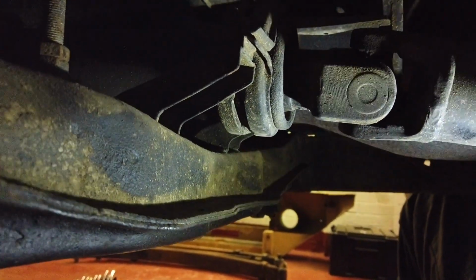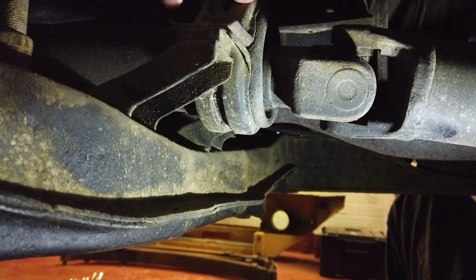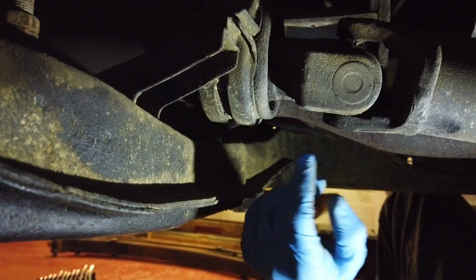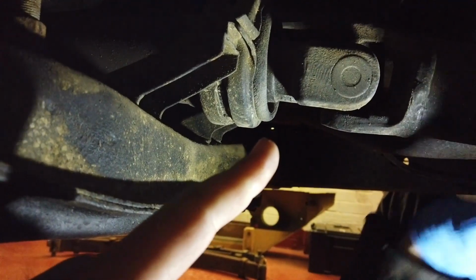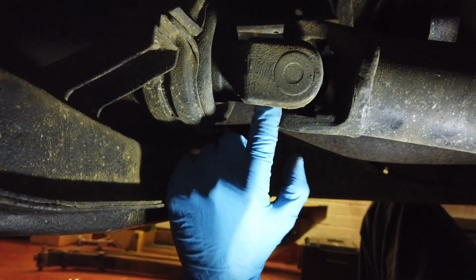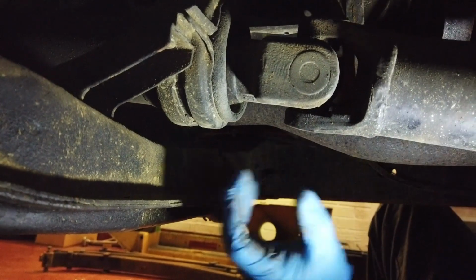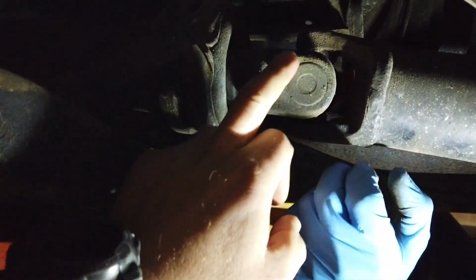So we'll fix that. I've got a replacement kit from Milner's, which comes with this bearing or this support. Yep. And it also comes with the UJ. We need to replace that. Well, I don't think we'd have to take that apart anyway to get it out. There's a nut inside there. You undo that, this part of the UJ comes off, and that slides apart. So you don't have to actually split this UJ then. So we only need to replace that.